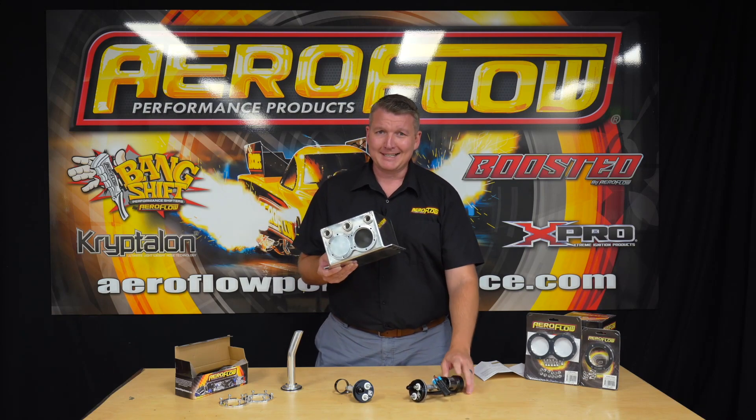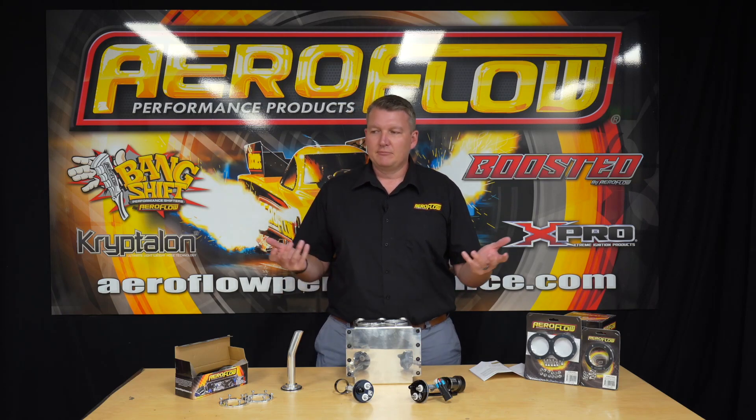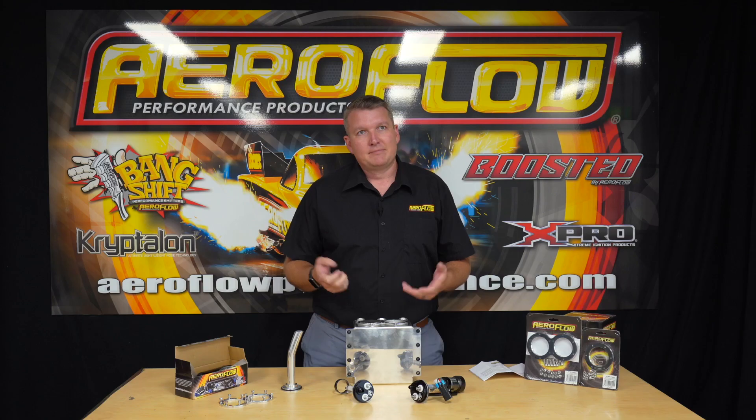While we still sell plenty of these tanks, we thought it would be nice to be able to put a 40mm pump in it. So you can go from a pump that's rated to roughly 600 horsepower at the flywheel on regular fuel, to something that's rated up to 700 horsepower on ethanol at the flywheel — which is something like your 525 litre per hour pump.